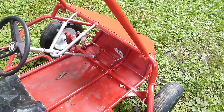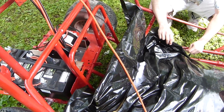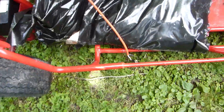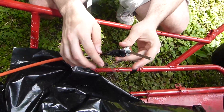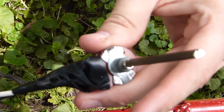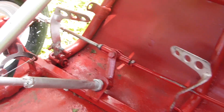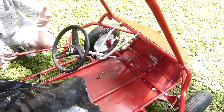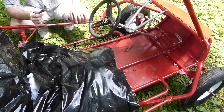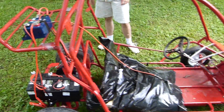Let's give her a try. The brakes do work — but the cable I have tied is not taut anymore, so I need to make it taut again. Still using a hand throttle — it's a 0-to-3K resistor. I have in the mail a 0-to-5K one, which is actually what we should be using. The foot throttle was a Hall effect thing, but it doesn't actually support 0-to-5V — even though it says it does. So just abandon all hope trying to get it working. I'll use the 0-to-5K for the full power range.